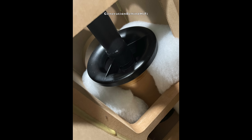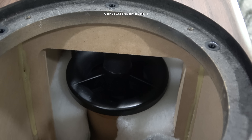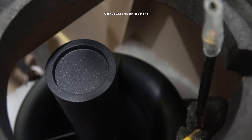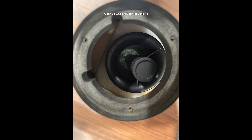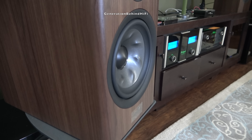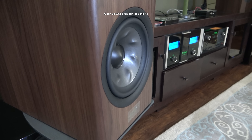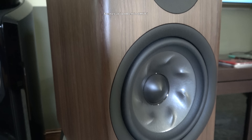This is by far the most complex bass reflex port I have encountered yet on a speaker. Ports are designed to allow air to escape from the cabinet for greater bass output, but simple port designs can create chuffing noises that mask the midrange and reduce bass output. Polk's X-Port is engineered to allow air to exit as smoothly and quietly as possible. Polk went a step further by incorporating eigentone filters — tubes placed in the center of the port — which use advanced acoustic analysis to identify specific cabinet resonance frequencies and cancel them out of phase, effectively eliminating them. This is similar to the concept used in noise-cancelling headphones. During my listening sessions, I couldn't hear any port noises, so whatever they're doing seems to be working.